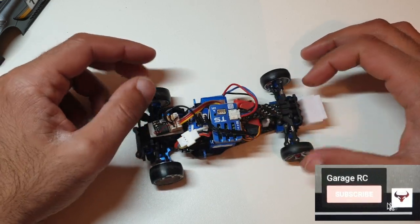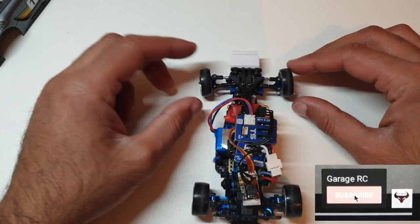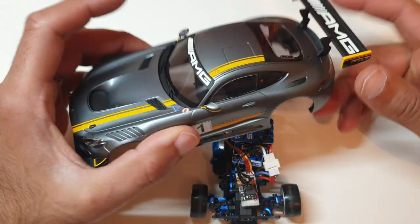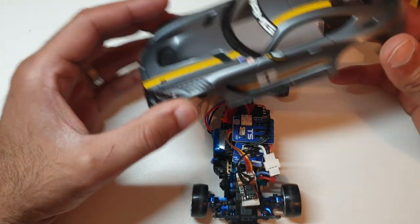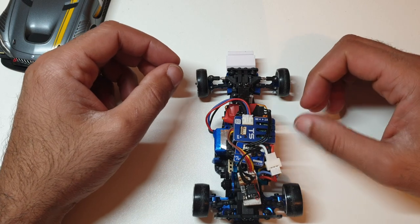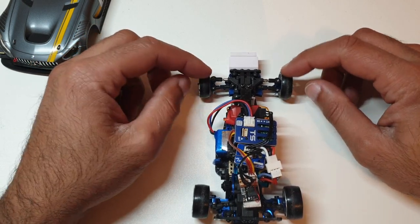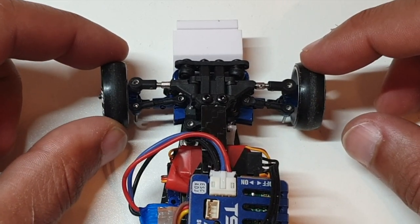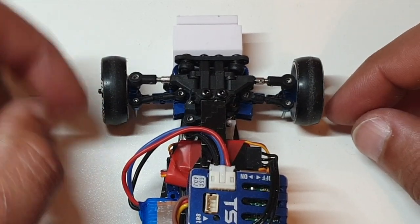Right in front of me I've got my XRX, set at 98mm, and I've got it set fairly wide. I'm using a Mercedes AMG GT3 shell which is very wide and enables you to get quite a wide offset front and rear. I think I'm running three at the back, and maybe only one at the front, but you can see I've got the bars extended pretty far out so I've got a quite wide track at the front.